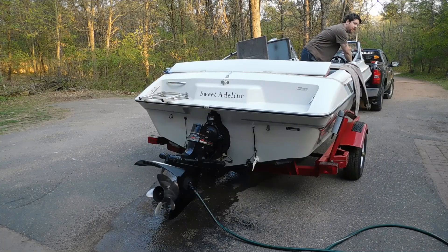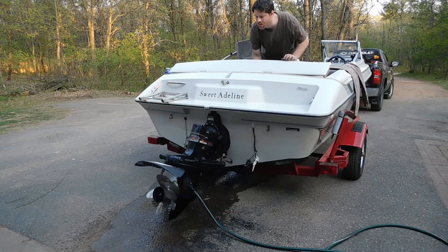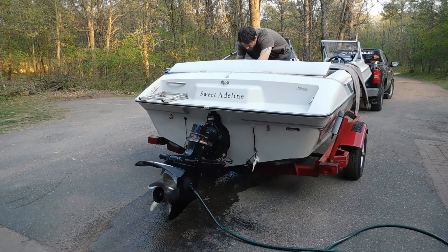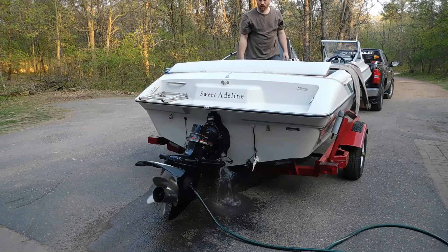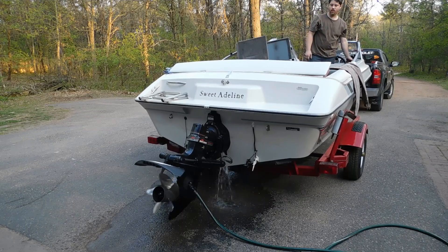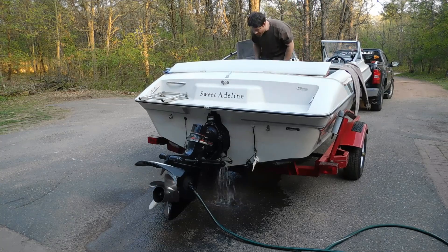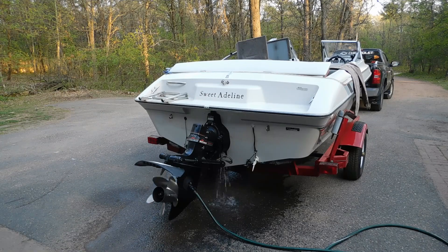Now it's time to move the boat out, hook it up to water, start it up, and make sure I did everything right. Also check for any water leaks anywhere, because there were multiple gaskets that have been tampered with and replaced. Even though I adjusted the rocker arms to zero lash in accordance with the service book, I still did end up experiencing some valve clatter. The fix is removing the valve cover and adjusting them until the clatter goes away, then going about a half turn more. The engine will want to stall a little because you're putting pressure on the lifters.